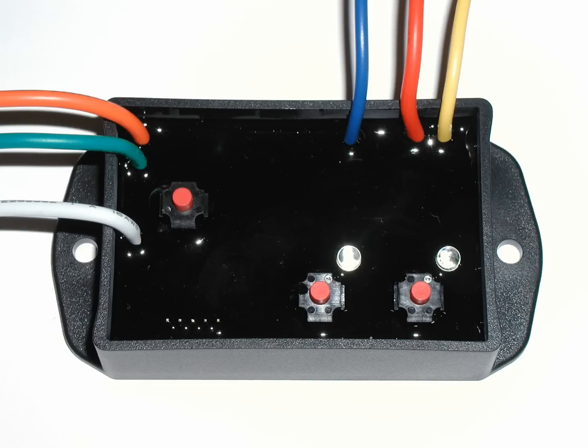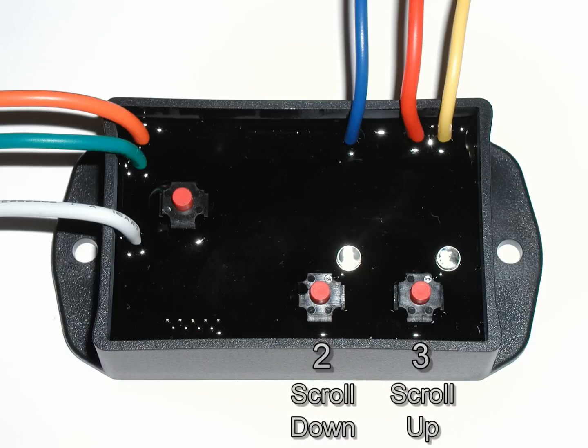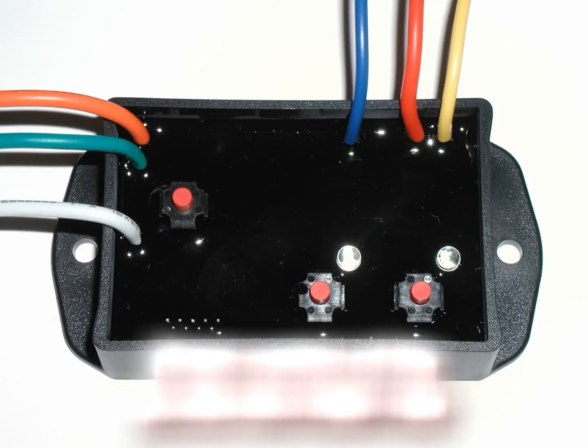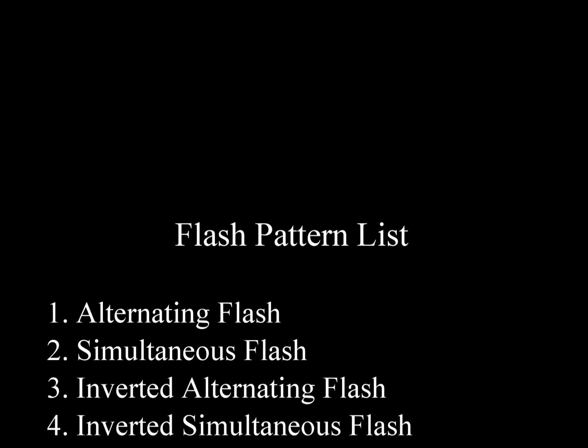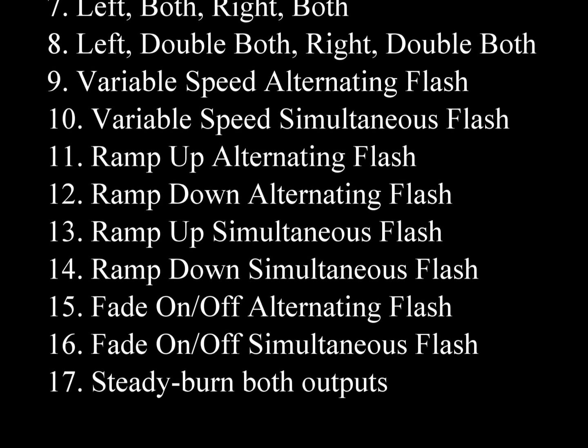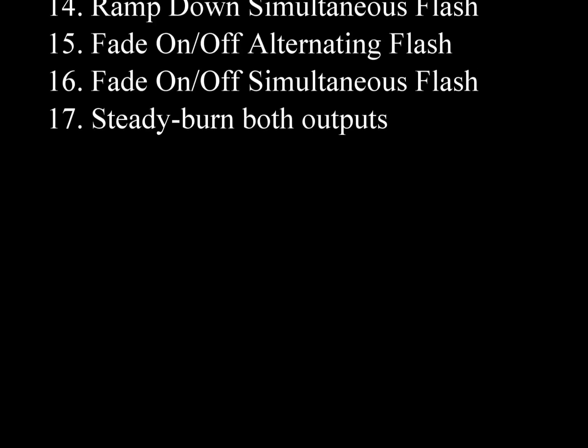To explain, this flasher is designed with three waterproof push buttons. The manipulation of these buttons is what gives you access to these features. As stated earlier, this flasher has 16 base flash patterns. Buttons 2 and 3 allow you to scroll up and down through the flash pattern list. While on each pattern, you have the ability to change the number of pulses and flash rate of each pattern. Now instead of choosing from the provided list of patterns from traditional flashers, you can set your own pulses and rates. Our pattern list is an assortment of unique patterns for you to select from, and you have control of what each one does.